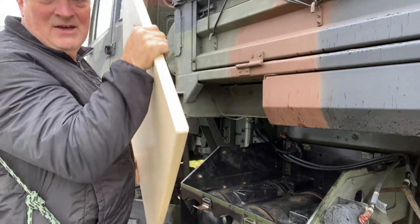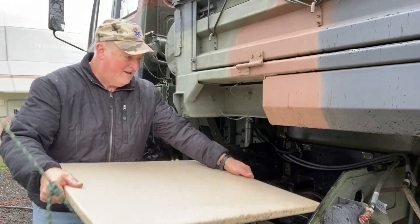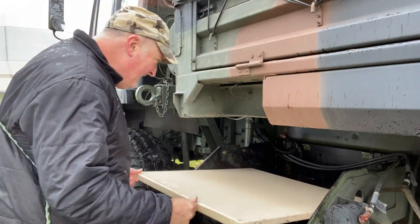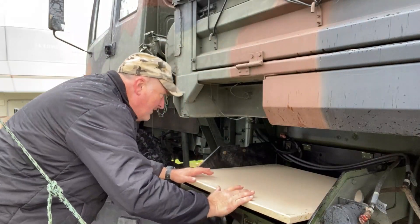For my new platform, this is made out of a bathroom stall board. I know you're probably not going to be able to find that, but I was lucky enough that Bob actually had one. Not everybody is going to have bathroom board, but you don't have to use that. There are folks that have put big pieces of aluminum down — quarter-inch thick or so. You could even put marine-grade three-quarter-inch plywood down; that would work just fine and last for years to come. There's not a whole lot of moisture that gets in there, but there is some. As long as you have a deck that is going to support these heavy batteries, you're going to be good to go.